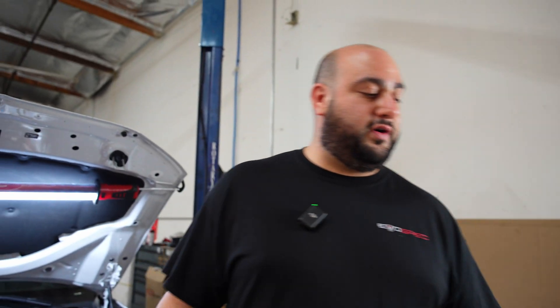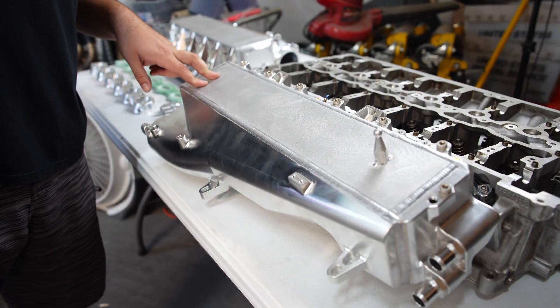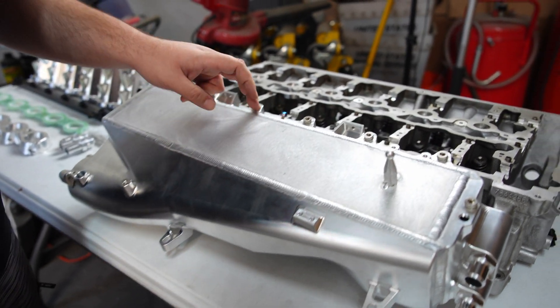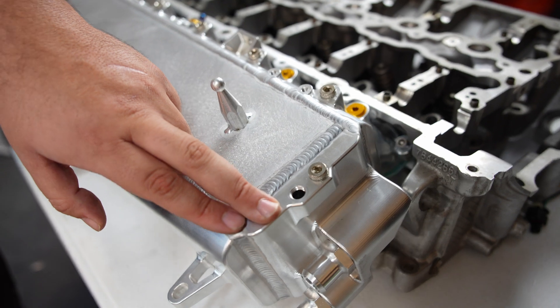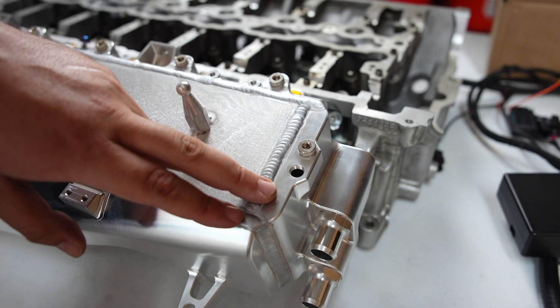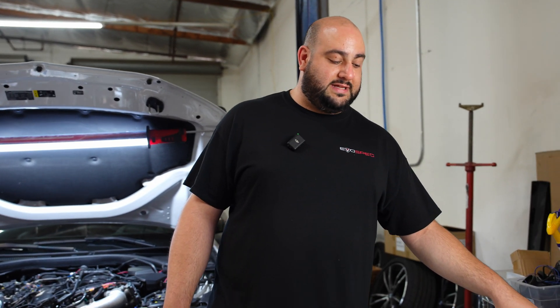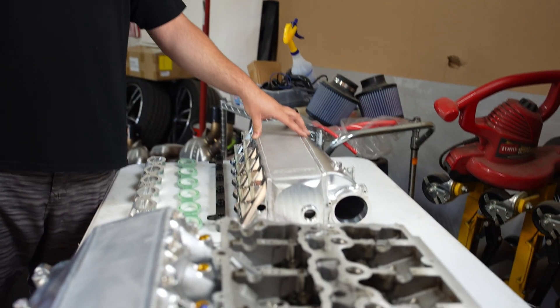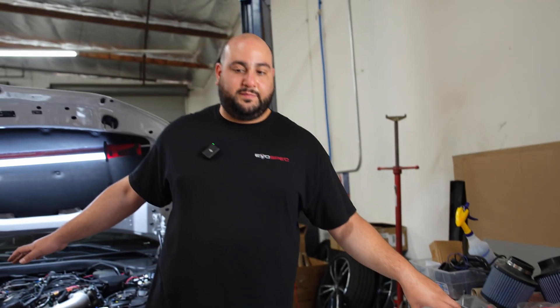This core is good for 2,000 base horsepower. Coming over to our new F-Series Billet intake manifold, this one is good for 1,500 horsepower, and has methanol and PI ports as well, with extra NPT ports off the water side for temp or pressure readings. On this car, we're going to be installing the Race intercooler intake manifold system with 750cc injectors, swapping from the PI spacer, and simultaneously installing the CanPort PI controller.